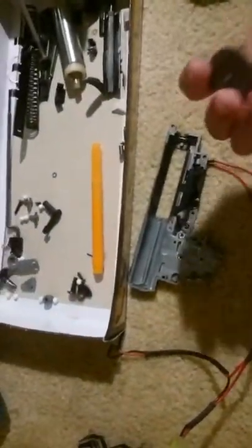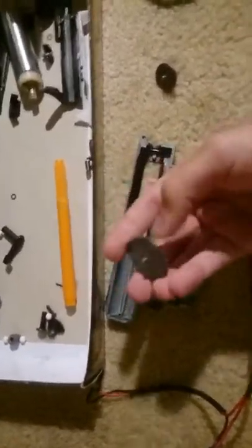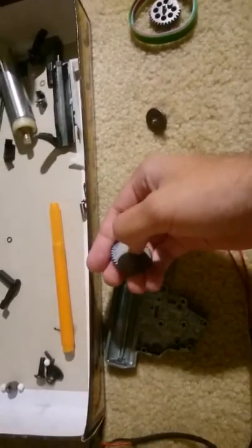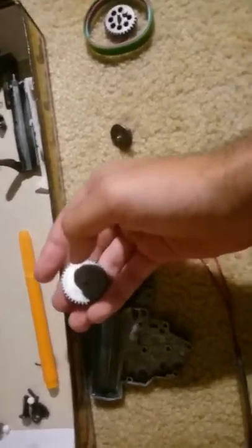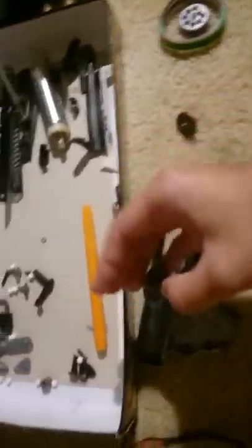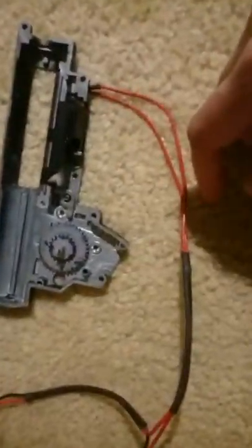So, when you stick these things in, you have to make sure the shims are on them properly. You have the lubricant under here, in this little spot right here, and then you stick the shims on there, and it's really creamy. So you get the shims right on there, and they don't come off, right? You have to put lubricant in between the shims, and you just stick that right here. That's the first gear to go in. Here's the second. You have to make sure both of the shims are lubricated. It'll reduce the wear in the gearbox a lot.